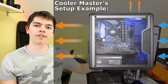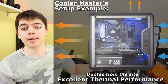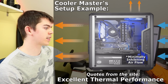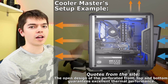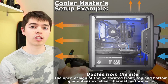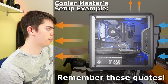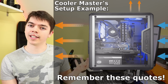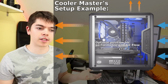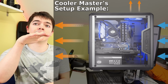Well, for a start, it's not propped up by the graphics card stand, which is fixed to the bottom of the case. It actually seems to just be very lightly touching the power supply cable for the graphics card, so completely useless feature there. It's actually inhibiting airflow through to the graphics card, which you will notice is on the bottom slot, which is likely to be a x8 slot, PCI Express lane, so you're going to be wanting to use the x16 slot, which is generally the top slot. Very rarely will you have two x16 lanes on a motherboard, so you'd want to utilize the top slot. Regardless, if it is a x16 lane, could be, then you're going to be wanting to have it on the top slot regardless, because it would also be a guaranteed x16 lane, and it would give you better airflow than squeezing it towards the upper part of the power supply unit.